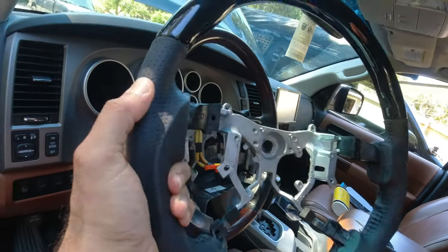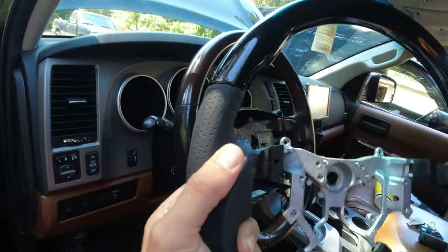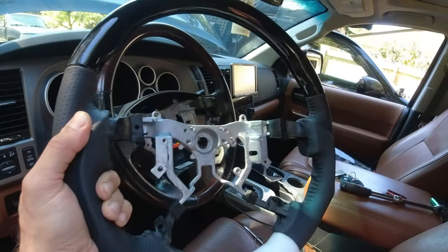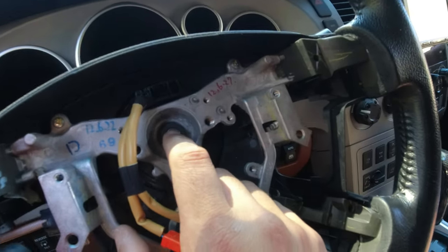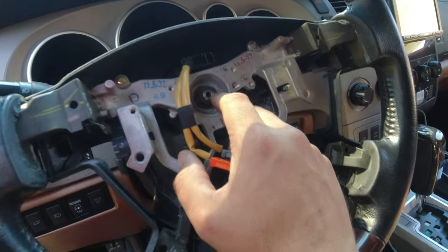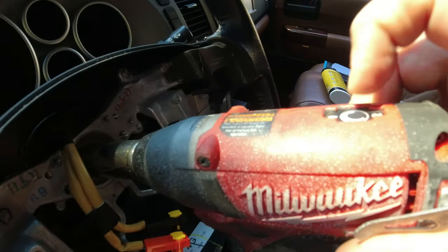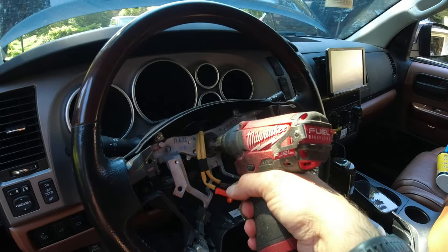The leather is perforated, it's a little bit higher end leather, it's brand new — not weathered like this. So far all the holes match up, so I'm really stoked. We can continue with the steering wheel removal. In order to take off the factory steering wheel you have to release this main nut — it's a 19mm. I've had great luck zipping this off with my Milwaukee impact on the highest setting; it usually just pops right off.